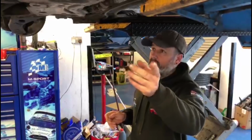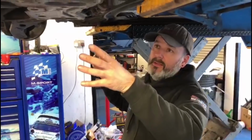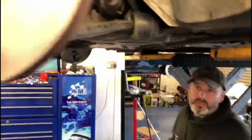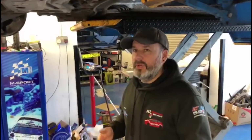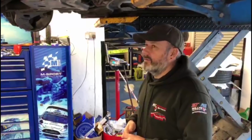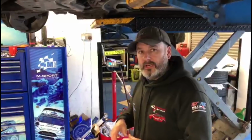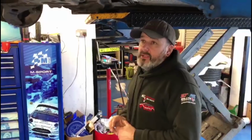As you can see, look, everything that we've done on the drive shafts, everything to do with any torque bolts, it's all tightened and marked, bottom ball joints, everything. Obviously wheel nuts, people don't want paint on their wheel nuts, so that's the one you can't do, but we always have one of us there just to double check. It's peace of mind, isn't it? That's it, guys, really.